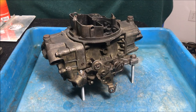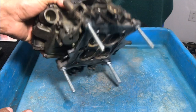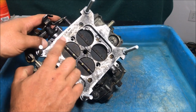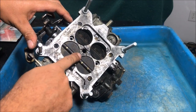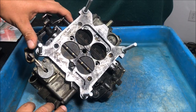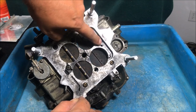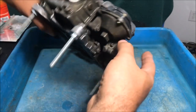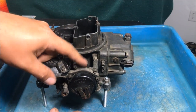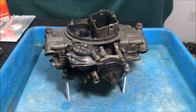Hello, I'm Chris and this is my Holley part 7 video. In this video we're going to be going over a lot of different little repairs to these carburetors. The main thing is the throttle shaft repair — we'll show the plastic/nylon bushings the kit comes with, but I also bought the reamer and we're going to ream it out and put in the correct brass bushings. We're also going to add check ball blowout protection, tap and drill the hot air choke hole, fix the vent tubes, and go over any other random information.